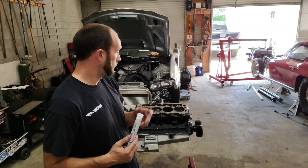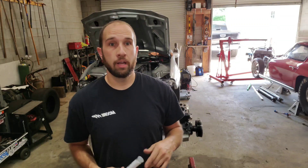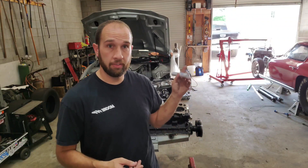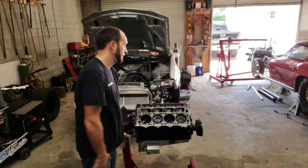Afterwards, once the epoxy sets up, I take the plug out of the side of the block, run some water through it, and it washes all the sugar out from under the epoxy — and you're left with wide open water passages that you can circulate water through. I've already done that on the other side, so I'll turn you guys around here and show you what it looks like, and then we'll work on this side of the block.